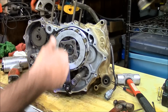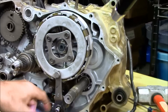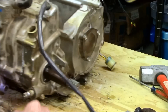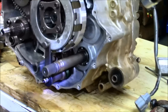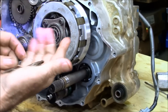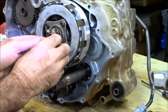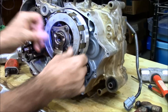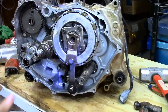Now you're going to install the mechanism that actually activates the clutch. There's an ear here that goes in between the spring. It slides on the shaft. Make sure that the index on the shift shaft is in the center, as you see it right there. And you have the bearing — it goes in this hole, has a recessed part, and this only goes on one direction, as you can see. You can't put it on the other way; it won't fit. This rides in the bearings, this rides on top. That is how it's installed correctly — it should look like that.